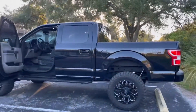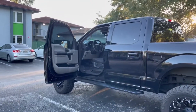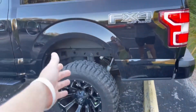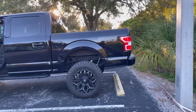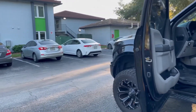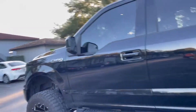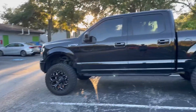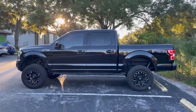The true lift was an exact six inches from the lift kit, plus one and a half inches from the tire — because it's a three-inch difference from 32 to 35, but you only measure half of the tire since half is on the floor. So that is seven and a half inches total. If I went with the Rough Country coilover kit, I could get closer to nine inches of total lift because the vertex coilovers can be adjusted to about seven-plus inches. If you went with 37-inch tires and the Rough Country six-inch vertex coilover kit, you could get closer to 10 inches of total height.